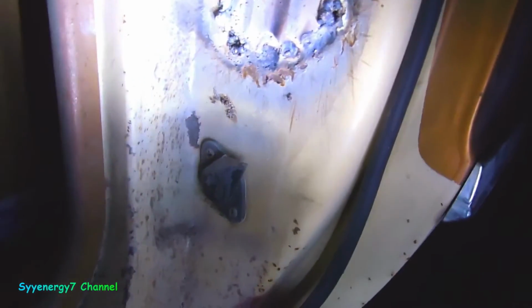And then I already got the door figured out, and I got to do behind the quarter panels. And the main thing is to get that Rust Veto 344 all across the bottom on the frame, inside the rails, everything, because it's a matter of preservation is really what I'm looking for. Getting rid of the rust, cutting out all the old rust, making sure nothing rusts further, there's no holes. And it's not too bad of a job. There's a couple little pinholes in there, but like I said, I'll get that with the panel adhesive, and you'll never know it was there.